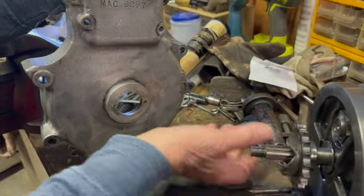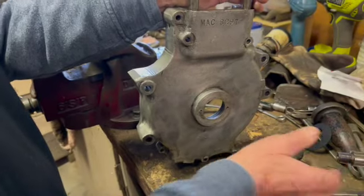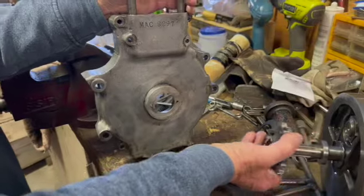Okay. So Ian might have to have a look at the gearbox alignment too, because they might have moved that across to make up for it. They might have. There is a bit of leeway on those. You can undo the bolts and you can actually slide the gearbox across a little bit on the frame.